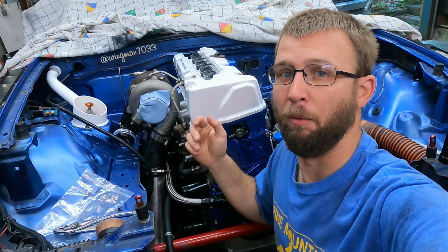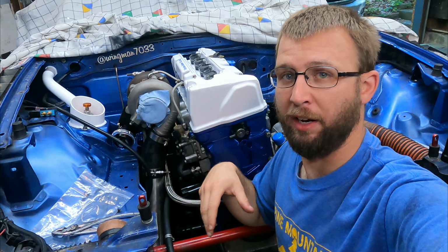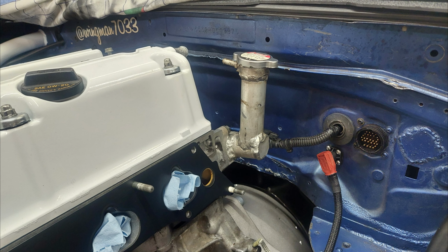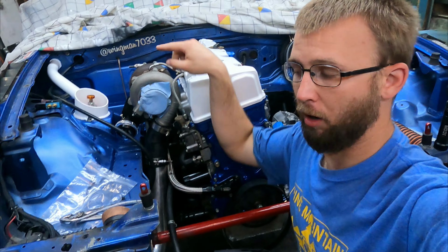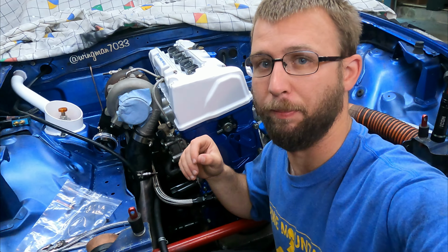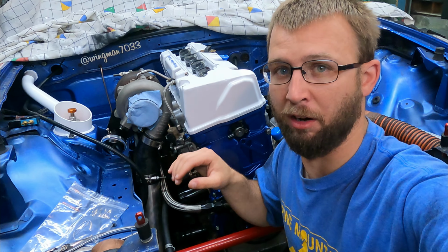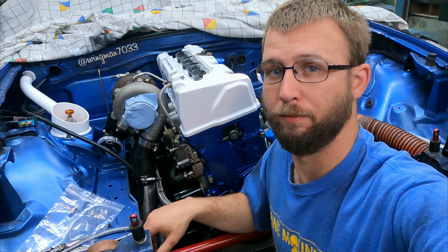Obviously, that's not ideal. So what I'm gonna do is take that original K-Power water neck that I've already modified and added that rear coolant fill port to, and I'm just gonna weld an aluminum tube to it and run it all the way down under the turbo bits to right about here, which is where the radiator is gonna be. Then I'll just have a single rubber line going from that to the radiator. Should be a lot simpler, a lot stronger, and a lot more reliable.